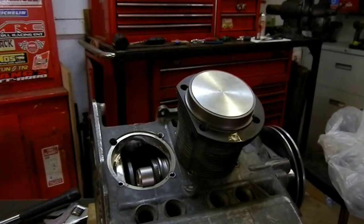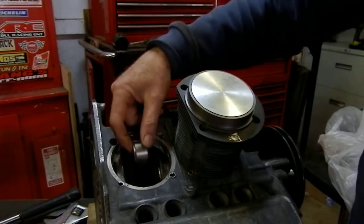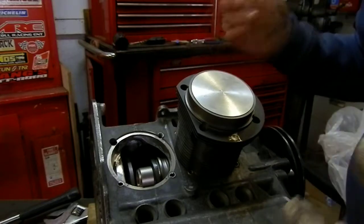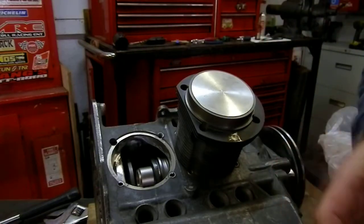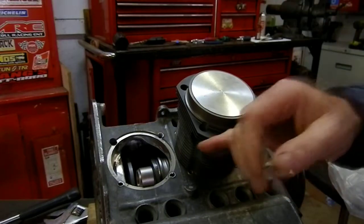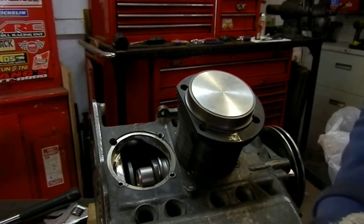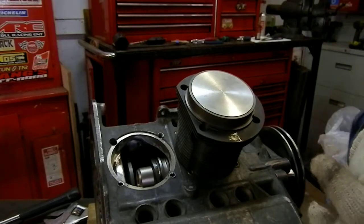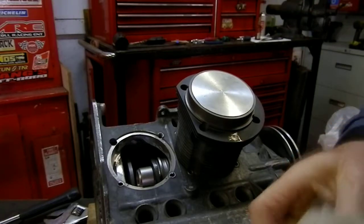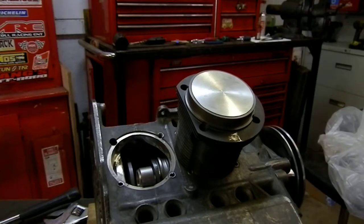That's just one of the measurements that has to be done, and of course there are lots of different adjustments being made to the inside of the case. I think I've had this case apart about six or seven times now, back to the grinder to open it up to give enough room to allow this 82 millimeter crank to wipe through there. I'll continue on with some videos and keep you guys informed on different things you should be looking at for building up high performance VW engines.